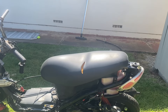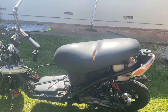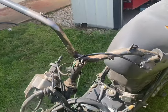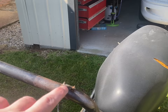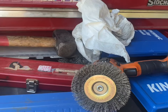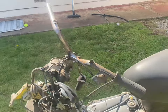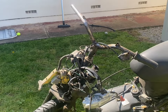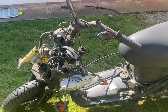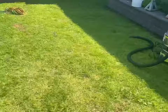When I went to start it I was having trouble starting, so I've decided to buy a new carby, which is on its way in the post. I've also stripped the handlebars off and started stripping the paint and rust off them with a wire wheel on the drill. I've got some new brown replacement grips ordered from Rogue Customs or Rogue Motorbikes in Western Australia, and those are on their way too.